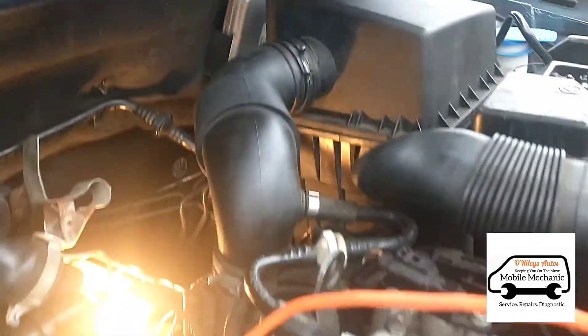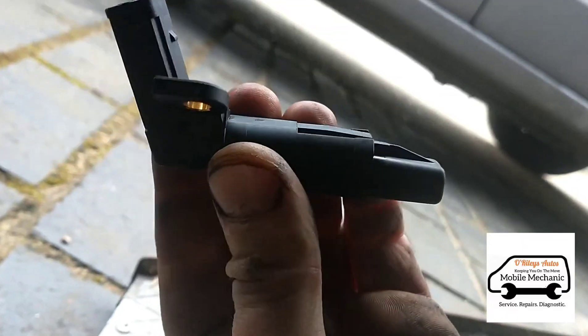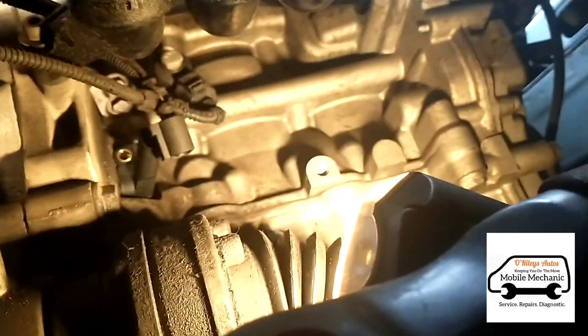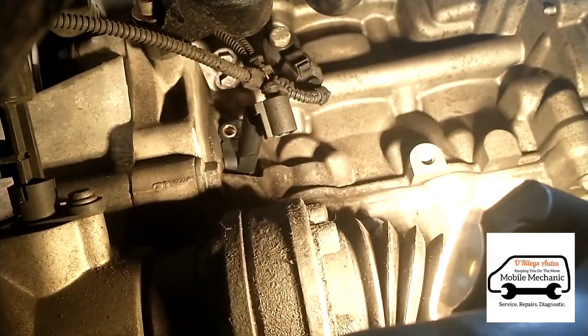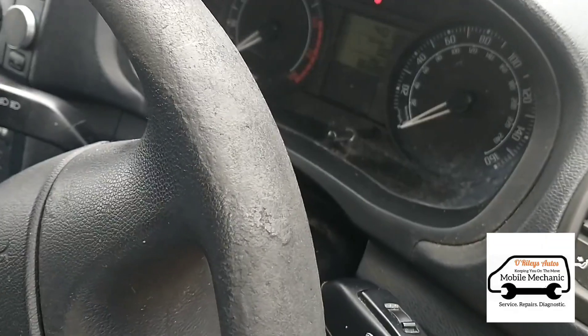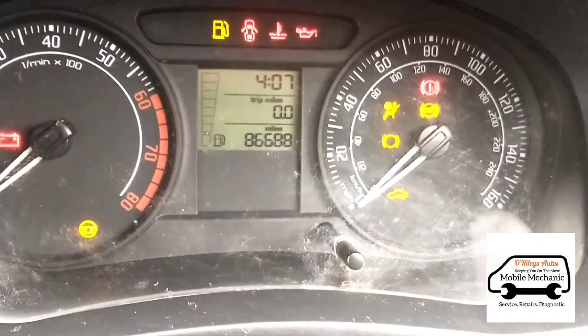No fuel and no spark is probably pointing to either an ECU problem or a crankshaft sensor. We've got a spare crank sensor in the van so we'll try fitting one before spending a lot of time going through other things - it doesn't cost much, about 20 quid. We've got the replacement crank sensor fitted just behind the engine underneath the intake manifold. Now we've plugged it in and suddenly we're getting something different when we turn the key - the key light is now flashing, which wasn't happening earlier.